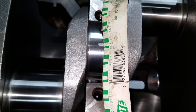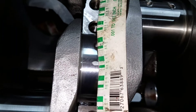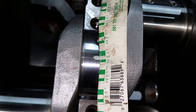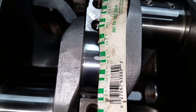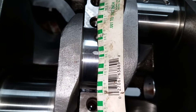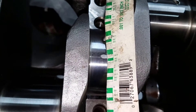I put the crank in here and put on the middle cap, torqued it down to 100 foot-pounds. I can see here that I'm at 0.0015 for my bearing clearance. Using my little guide here on the ruler — this is a standard new Eagle crank that was balanced in a new line hone. I don't always check everything, but this is my personal motor and I just did it and thought I'd take a little clip of that.